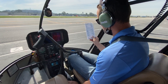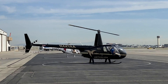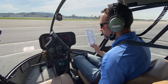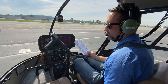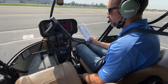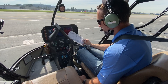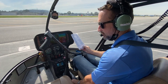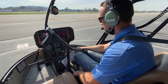Pull the checklist out for the shutdown procedure. We're going for 60 to 70 percent RPM — closer to 70 is better because the squirrel cage fan in the back pulls in more air and cools things down faster. Frictions are on. Now wait for the CHT to drop — aim for around 300 degrees. On hot summer days that might take a minute and a half. This aircraft didn't get very hot, so we're already below 300 at about 280 degrees, so we can proceed.